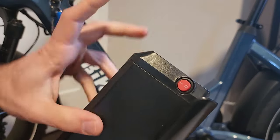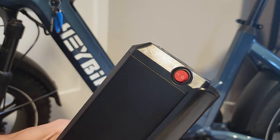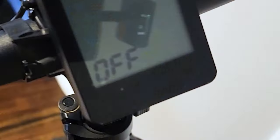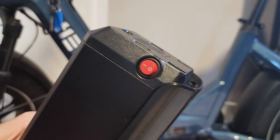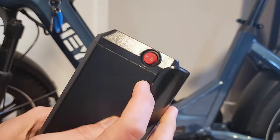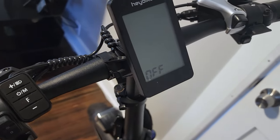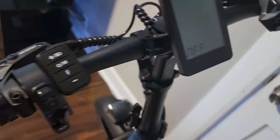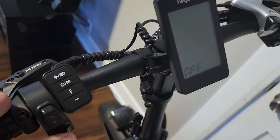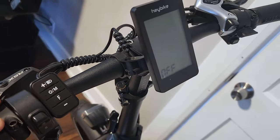To use this bike, make sure the battery is turned on. The battery will constantly stay on and give the bike a little power — the display always shows an 'off' notification. If you want to truly turn the bike completely off, either remove the battery or turn the battery off via the red switch. Even with the bike showing 'off,' you can still turn on the headlights and turn signal. So if you want to fully power down, flip that red switch on the battery.